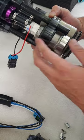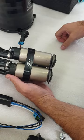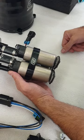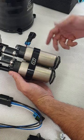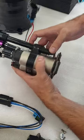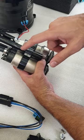As a third staged pump, we're using a Walbro 460, part number F90000274, which is a higher pressure, higher flow edition. We could have used the Walbro 535s here as well — they're also a great pump and we'll profile them more going forward. A lot of people haven't paid much attention to the 535s, but they're a great pump.